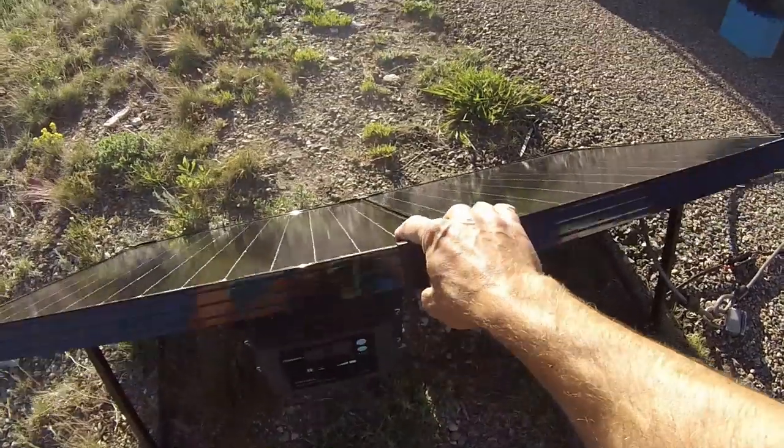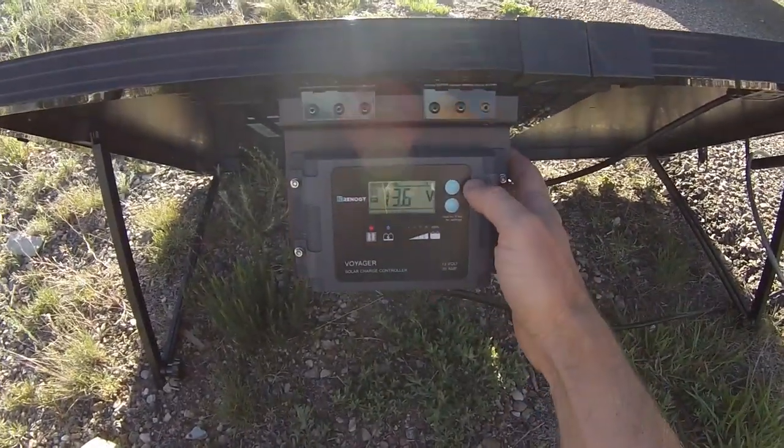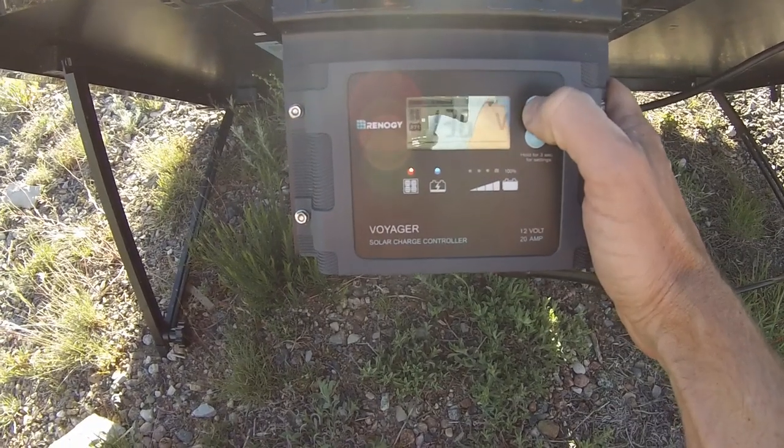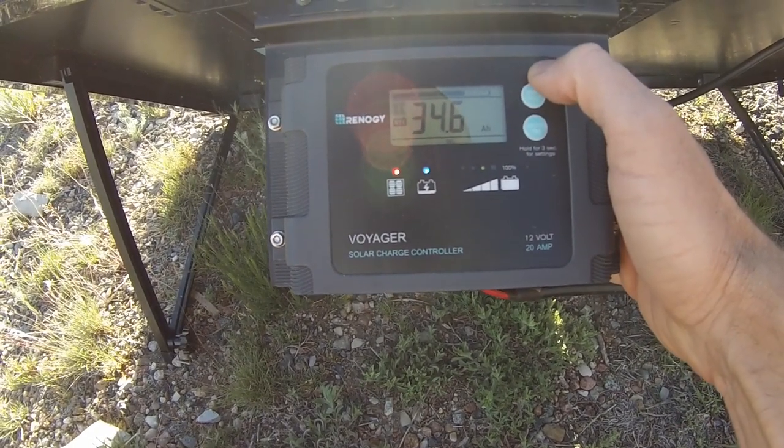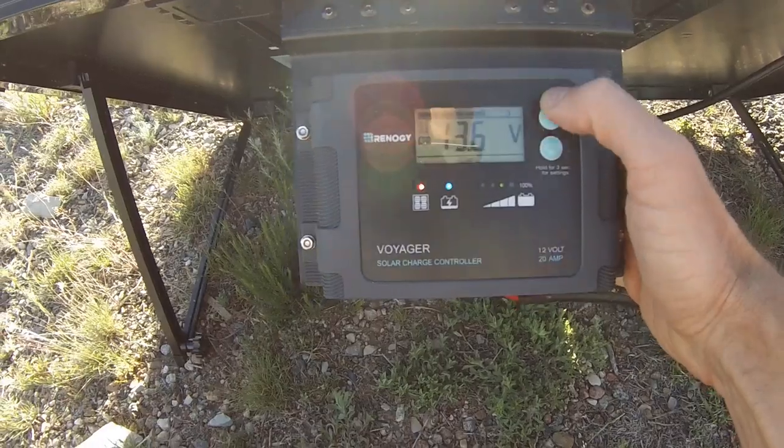We did not recharge this battery very much from solar on this trip. On Saturday our panel was outside for about 13 hours and we only brought in 37 amp hours. On a normal day we're bringing in 60 to 65 at minimum, so we were not getting that recharge like we normally would. Overall this battery did awesome. The only thing I'm realizing now is that I probably need more solar panels to get this battery fully charged — I'm planning on adding another 200 watts to the roof, or maybe getting another briefcase, to make sure I can fully recharge it.